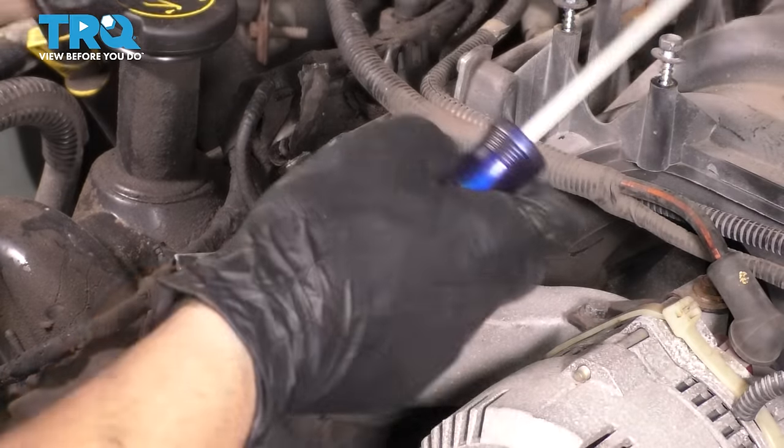This is your PCV. This assembly is a heated PCV with coolant, so it has two coolant hoses that go into here. You can see one comes off of the water pump tube off the back, comes into the PCV on the valve cover, goes back out into the throttle body over here, right where the vacuum hose goes in. Then it comes out through this hose, which will plug into the intake. And one of the only other hoses here is a coolant hose, this main heater core hose that also plugs into the intake. So let's get those in.